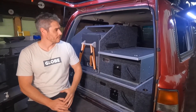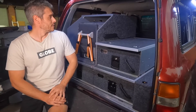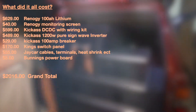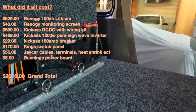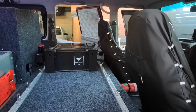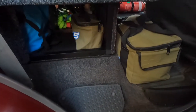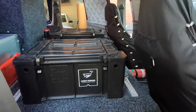This is the back of the truck all together. We've got a power board here which is wired to the inverter for appliances like coffee machines and that sort of stuff. The fridge is back in and the wiring is tucked away behind it, so it looks pretty good. For a complete breakdown of all the prices and parts used, the grand total is $2,016. Please note that can be heavily reduced by using a smaller inverter or in fact no inverter at all. Now for all the AGM naysayers — you're right, AGM is cheaper, but to get a similar available amp power it really isn't that much: it works out at $570 for the similar spec Century batteries.